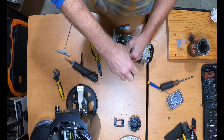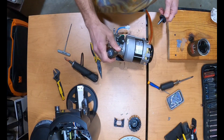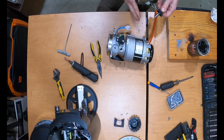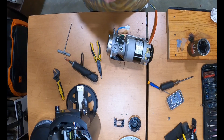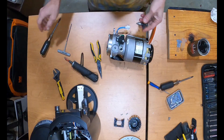The screw is actually holding the gear to a metal tapered pin, which meets up with a tapered hole. That pushes or releases the bottom burr to go up or down. Once you replace the gears that you're having trouble with, you can put them back in.